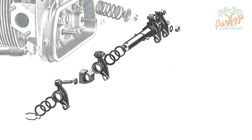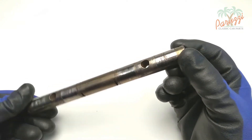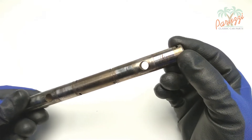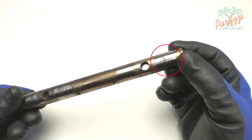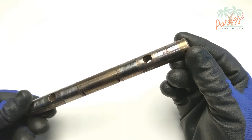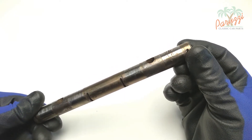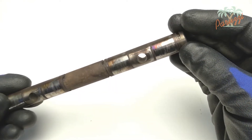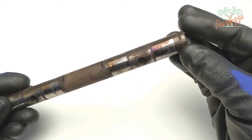Let's start with the base on which everything rotates or tumbles — the rocker shaft. The sliding surface over which the rocker arms rotate will experience the most wear. You can see that in these images. This is a rocker shaft from a type 1 engine with a lot of miles on it. Note the deep groove in the metal of the rocker shaft — this indicates a lack of lubrication. When the radial clearance between the rocker shaft and the rocker arms becomes too large, the oil pressure at the rocker arms will decrease, and the rocker arms will get too hot, causing more wear.